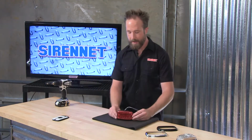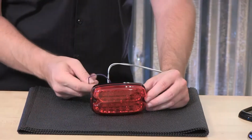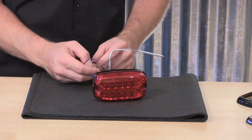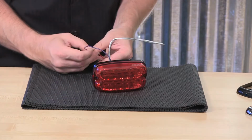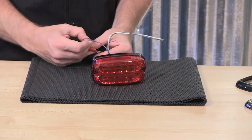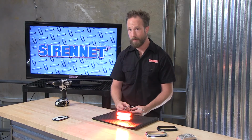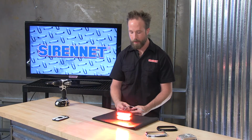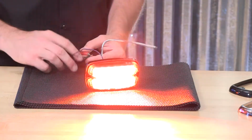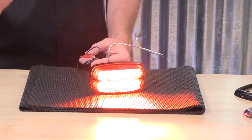Go ahead, turn the light head back on. The high-low intensity wire, when applied to a positive 12 volts, will reduce the current to the light head, putting it into a low power. Take it away, back to full intensity it goes. So with that, if you'd like to have an additional switch in the vehicle, a secondary master for intensity control for a daytime, nighttime mode, you can go ahead, take the violet trigger control wires across from the multiple light heads, put them to a 12 volt switch, and there you go, nighttime control.